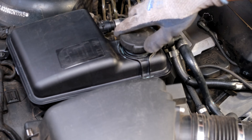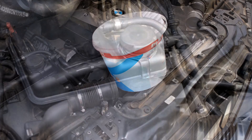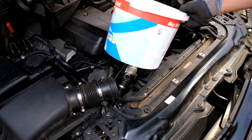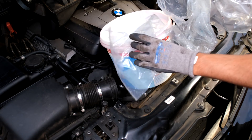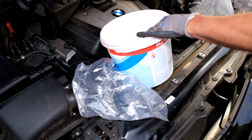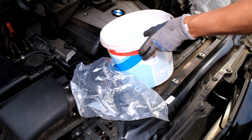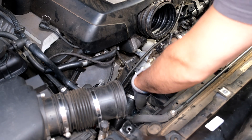I'm just going to release any pressure built up, keeping in mind that one cannot do this job if the car has recently been driven — the car needs to be cool. I'm going to reuse the antifreeze because this car has recently had a coolant flush. I've got a bucket and these airtight plastic bags — what I'm going to do is put the plastic by the pipe to capture the old antifreeze, put it in the bucket, and then reuse it when I put the thermostat back.